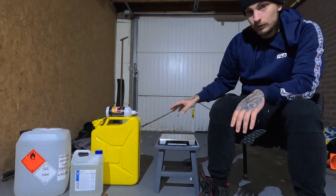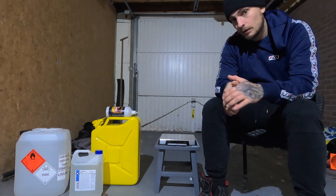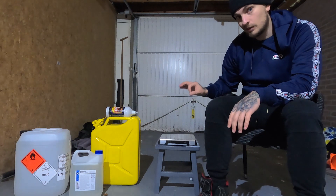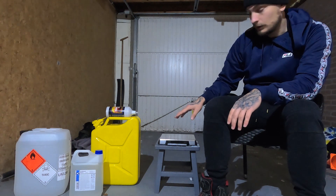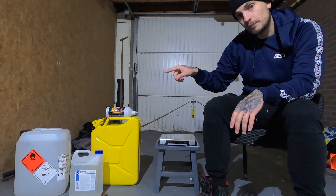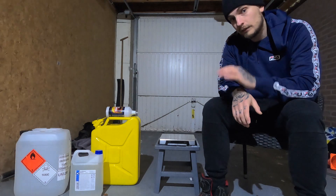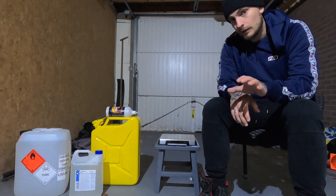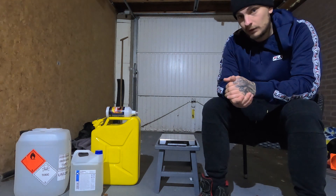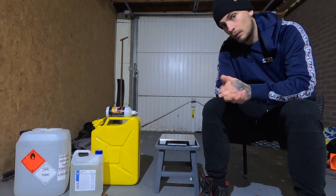That's why I got this little scale — it goes up to 15 kilos. What I'm gonna do: put the jerry can on the scale, tare it so it goes back to zero, put in the water and get a reading — say it's 5 kilos — then tare again and add 5 kilos of methanol, so we end up with a 50-50 blend, around 10 liters. If you want any other blend, like 30-70, make sure you calculate by weight and not by volume — that's the most important thing.